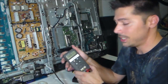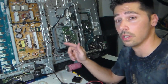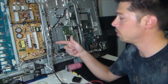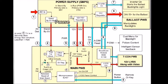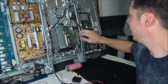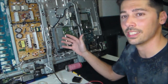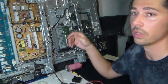When you hit the power button on the front panel of the TV, that signal doesn't go to the power board. It goes first to the CPU on the main video board, and then that sends the signal out to the power board that allows the high voltage to turn on, the backlights to turn on, stuff like that. The power board is like the heart, and this is the brains behind the operation. It supplies the standby volts to the CPU so it's kind of in sleeping or slumber mode. But once you hit that power button, that's when all the magic happens.